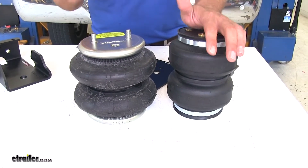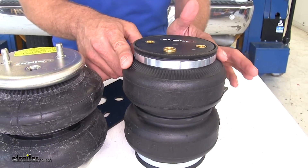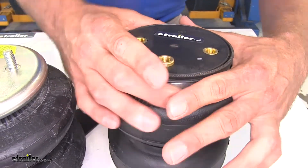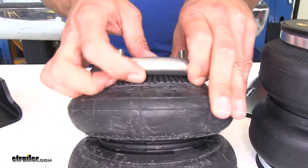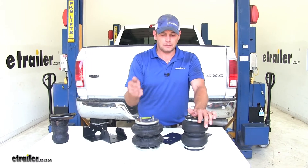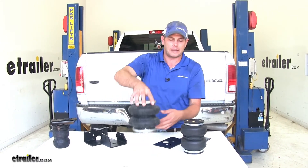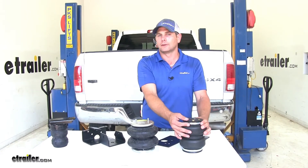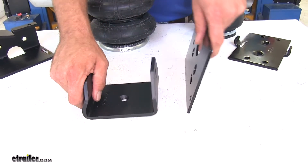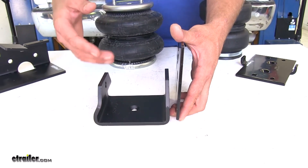Another difference that's really important is in the actual build quality of the airbags. The AirLift bag has the rubber portion of the airbag come all the way up and then clamp around a hard plastic cap. With the Firestone, they use what's called a roll crimp — you can see where the steel is actually crimped down around the airbag and grabs hold on the bottom side. That design difference means that with the Firestone airbag, for short-term general maintenance like oil or fluid changes, you can let your axle hang down from this airbag. If you try to do that with the AirLift airbag, it's likely you'll create a leak. The finish on the Firestone hardware is a little more durable, and the mounting brackets use a heavier-duty material, which should mean better support.